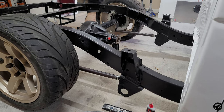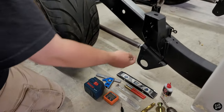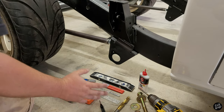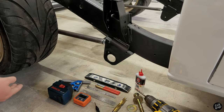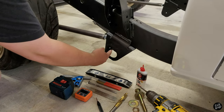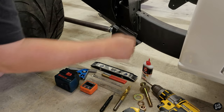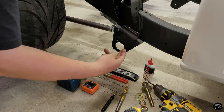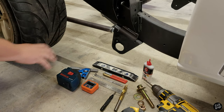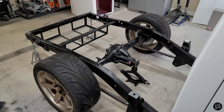What Chris and I are going to be doing at this point is drilling our new holes for the lower links. These links happen to be parallel to the ground, but we don't really care about that - all we care about is that these lower links are parallel to our upper links when we install those. This is the original mount where the leaf spring used to go, but since we're not going to be that high off the ground anymore, we're going to create a new one. We'll measure carefully on both sides, drill our 5/8" hole, and mount with 5/8" hardware through to the other side.